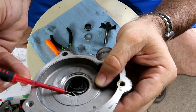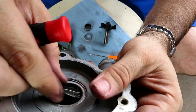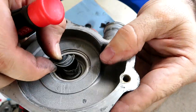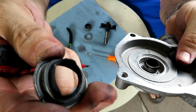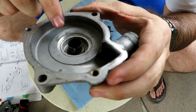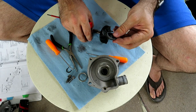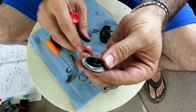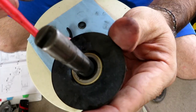All of it's really flimsy in here. You can see some cracking in that gasket material. This is all the kind of stuff that has to be replaced when you rebuild these things. According to the manual, this assembly here is the water pump seal, and all of this together was the oil seal. The only thing kind of chewed up is this rubber gasket material.